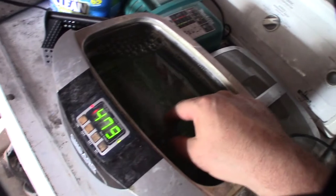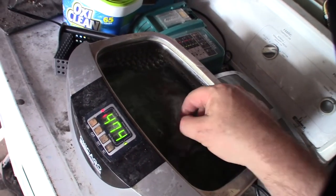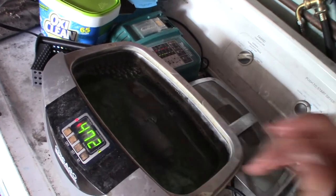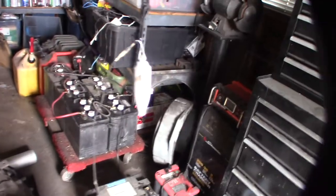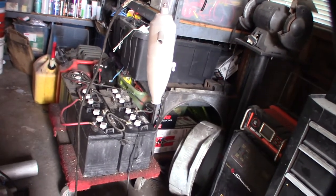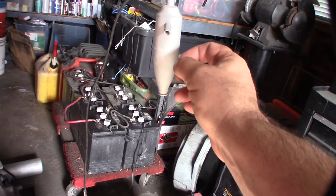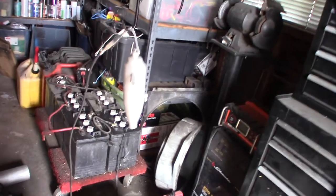Alright. Yeah, you got to make sure you really clean it the second after you've sandblasted, because you want a super clean surface for the powder coat to stick. One of the tricks is you have to make sure that part is super dry, because if it's not super dry, when you go to bake it, it's going to bubble. The moisture will escape and put a hole in your coating.